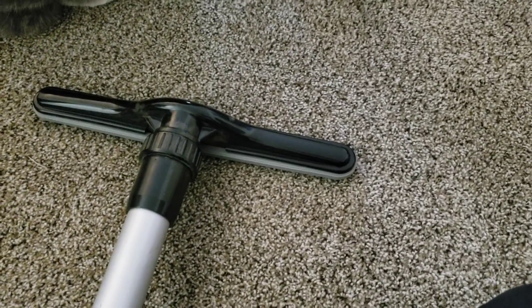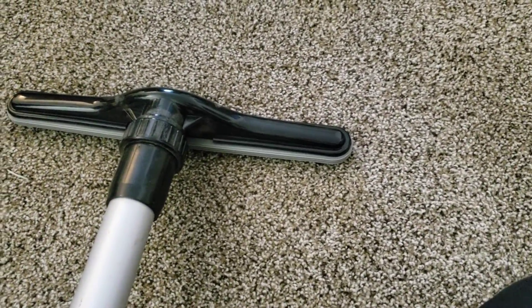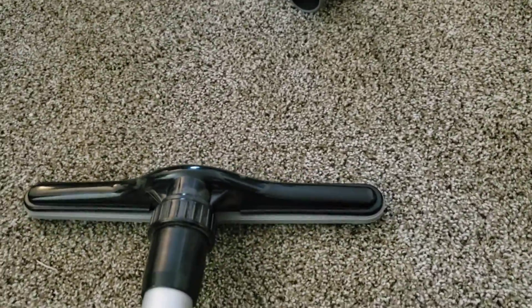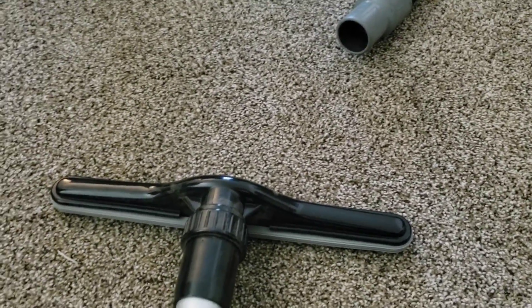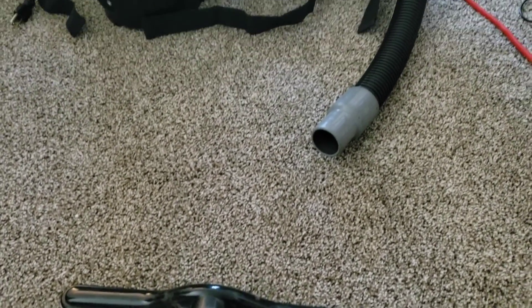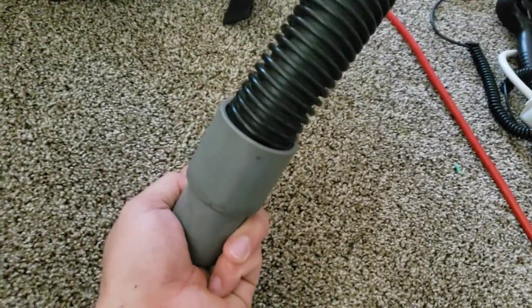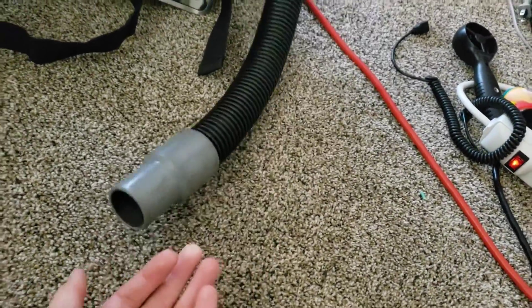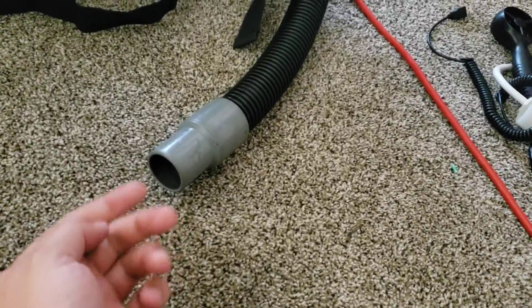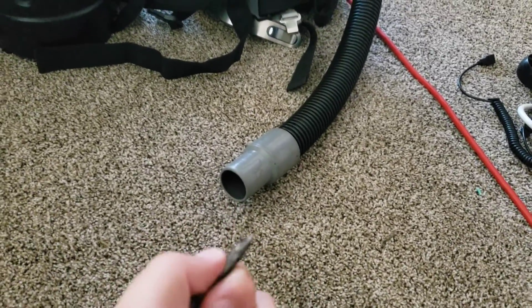We need to know the amount of airflow a machine has, and working vacuum doesn't tell you that. Airflow is what cleans — suction is not what cleans. The vast majority of people who have been in the vacuum industry for years will tell you that same thing, and they've often demonstrated it with a trick where they put something like a coin in their hand, seal it off, run the machine, then turn it off — it'll still be in their hand. We're applying maximum suction of the vacuum, but we're not moving air, and if you're not moving air, you can't expect to move debris.